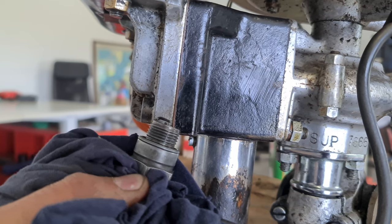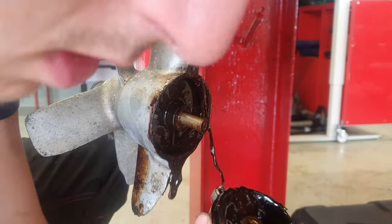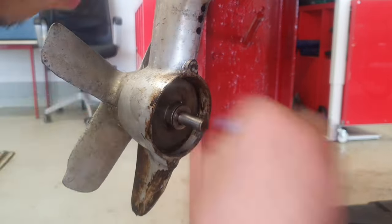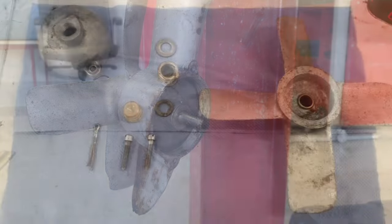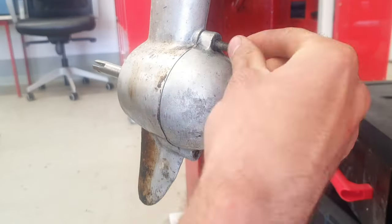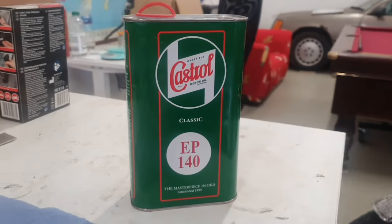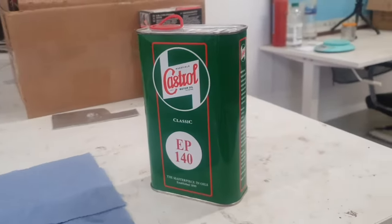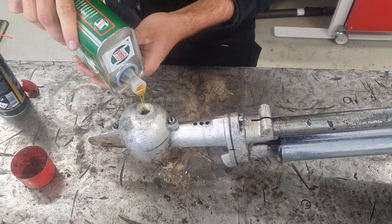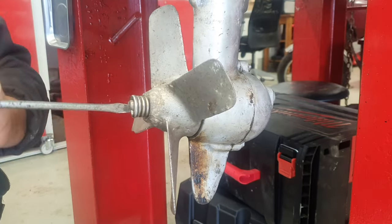You can see a nice clean spark there. Let's clean this out and add some new lubricant — this stuff is probably ancient. Got a few parts cleaned up here, nice and clean, and got some new wool as well. I got 140-weight castor oil, and these classic marine outboards took very thick oil in their gearboxes — even going thicker in very hot weather, up to 240-weight.